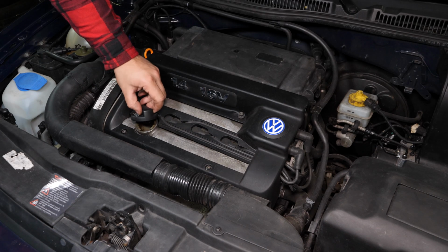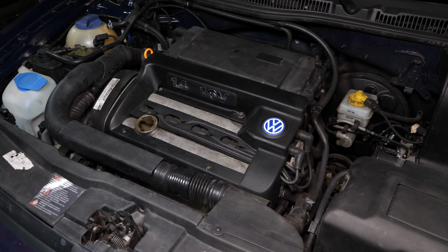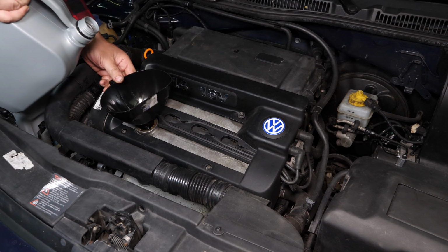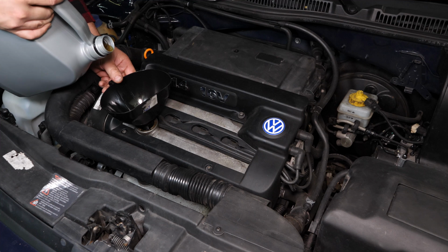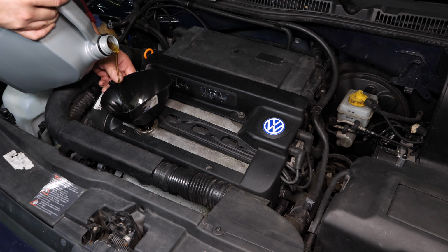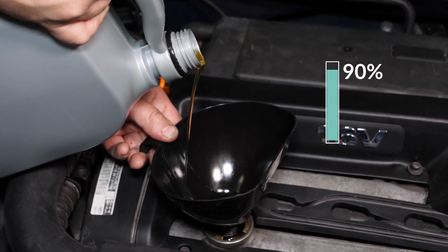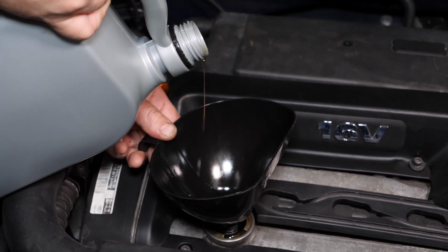Now add the oil into the engine. Begin by putting in 90% of the suggested amount. This will leave you a large enough margin to adjust the level of oil appropriately. You can find the exact amount of oil suggested for your car in the description of the tutorial.